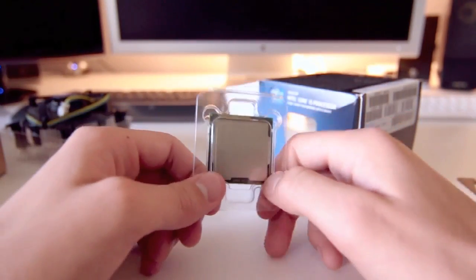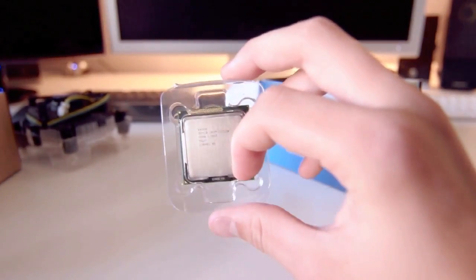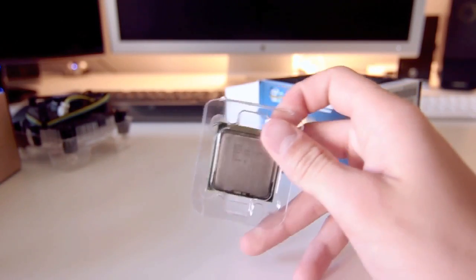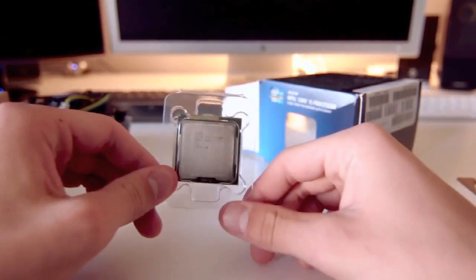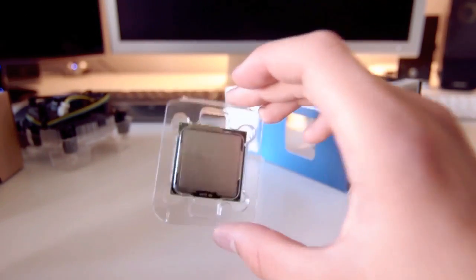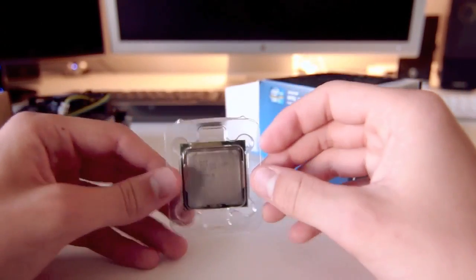This one is very easily Hackintoshable, and the Intel HD 3000 is nice — everything is on the die already. The new built-in memory controller for the Sandy Bridge is nice too, because it allows for a smaller motherboard configuration. They can add more things like more RAM slots, and it allows for a more precise configuration of the controllers. The memory controller, GPU, and CPU are all on the die now.